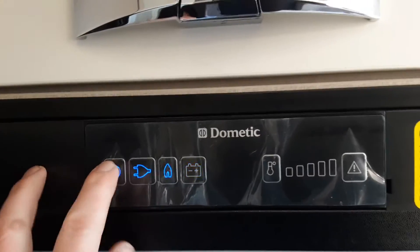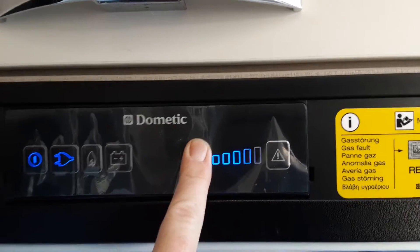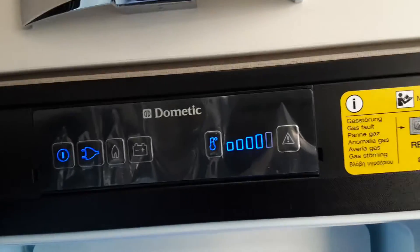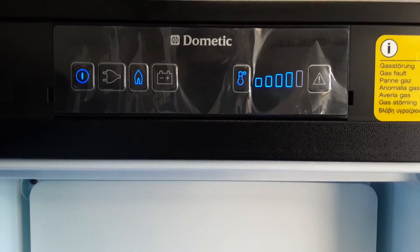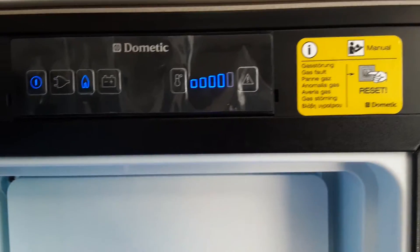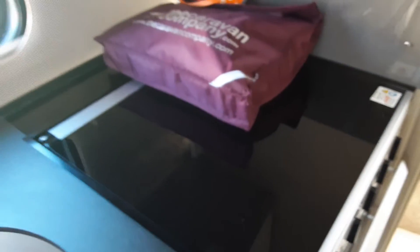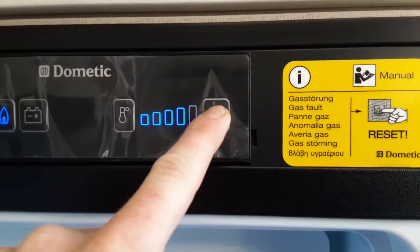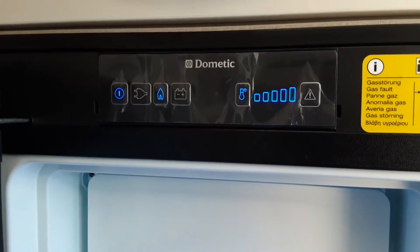The fridge is simple to use. Power on is on the left-hand side. You can run it on mains and use the button on the right-hand side to control the fridge temperature. To run on gas, the fridge will self-ignite as long as the gas bottle is on — hit the gas button at the top and when it ignites the light will stay solid blue. If it fails, the blue flame symbol and red warning triangle will flash. If that happens with gas available, go to the hob, ignite it to get gas through the system, then come back to the fridge, press the reset button on the top right-hand side, and it will start the igniting process again. On gas you can still control the temperature using the thermometer button on the right.